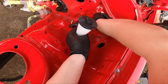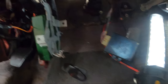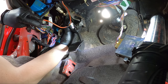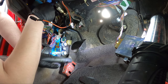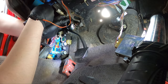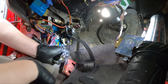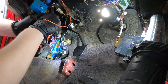This is where it's gonna get a little interesting. I can see it right here. I'm gonna set it in there and come under here. Here comes the fun part. I think I'm gonna loosen up this bolt for the clutch pedal and just line it up over the end of the master cylinder, then find my bolt hole again. It's almost going in. Maybe I shouldn't have taken my swivel socket off - I'm gonna put my swivel socket back on to get it at a better angle.